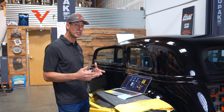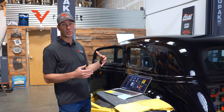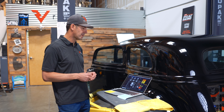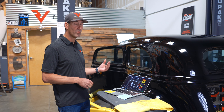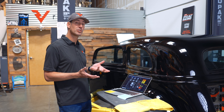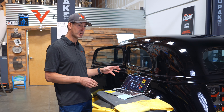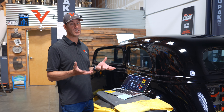What we did with the batteries is kind of unique — we plumbed the whole entire car, ran the pumps, and want to make sure it's going to cool every module correctly. There are 16 Tesla modules in this car and they're everywhere, so there might be a high spot or a low spot. What we did is apply heat to the front radiator that cools the battery system and watch the temperatures rise. Right now it's pretty cold — about 16 degrees Celsius this morning — so we'll put a heat gun on it, run some heat throughout the system, have the pumps run, and watch all 16 modules come up together.